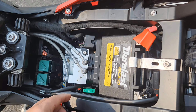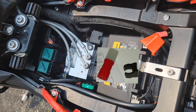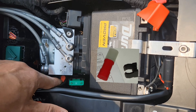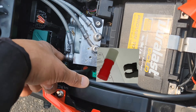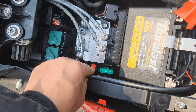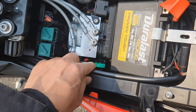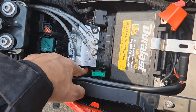Alright viewers, I kind of turned on my camera late. Apparently this S1000XR comes with a plug — this plug right here — and the connector for it was buried over there, and that plug was not connected. If it's not on, you're restricted to only dynamic mode. The dynamic pro mode gets unlocked when you put in this plug.